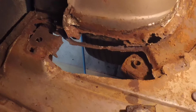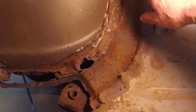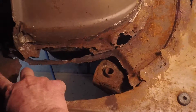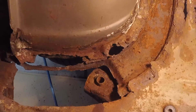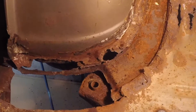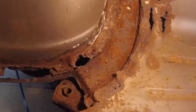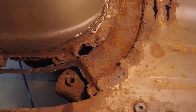There's no body mount there right now and the car body isn't moving or going anywhere, so I think it will be fine when I'm done. This is just a brace — you can see the two spot welds there. It literally goes from there around to there, and that's it. I can't find just that piece to replace it aftermarket. Sherman's auto body isn't too far from me and I don't think they make it — they make trunk pans but not the braces. So I'll just fabricate the brace and then repair the trunk pan there.